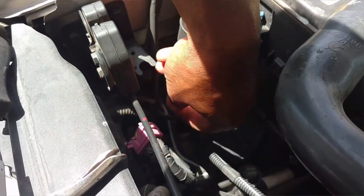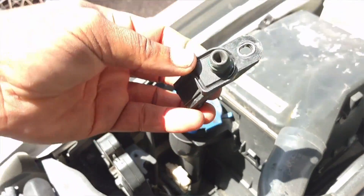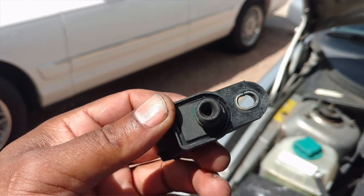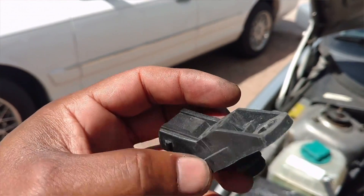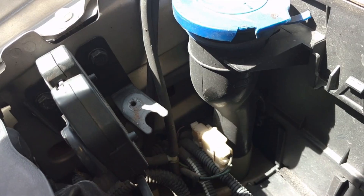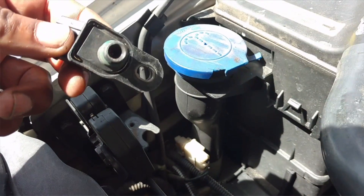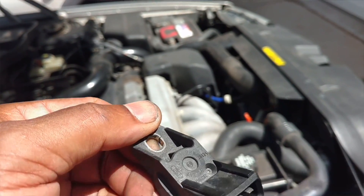And then the port comes out. It's best to spray that sensor with something like WD-40 or Mass Airflow Cleaner. Don't spray it with brake parts cleaner — that's a little too aggressive for it. I don't see that it was hooked up to anything. Once I pulled that screw out, it slid back and lifted up out of the vehicle. If that doesn't clear the code, I'll get one from the salvage yard.